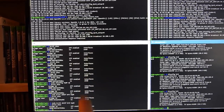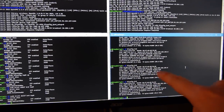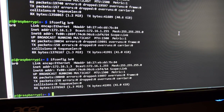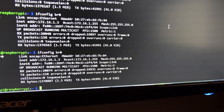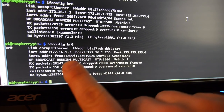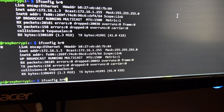I'm back at my main office setup troubleshooting from here, so I have everything in one place. Raspberry Pi one is on one Rush machine, Raspberry Pi two is on the other. Each one has multiple screens — one to show the VPN connection and one for looking at data and troubleshooting. I created a bridge interface to bridge the local Ethernet connected to the Rush with the TAP interface for the VPN. It should bridge those two interfaces and send all traffic over the VPN to everybody else.